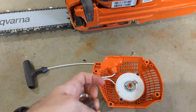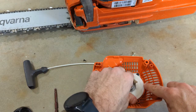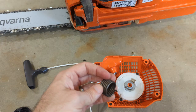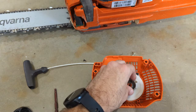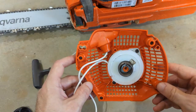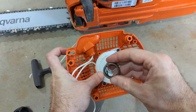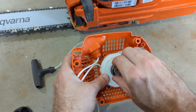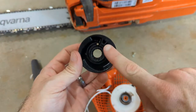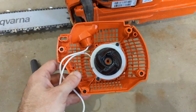So I dressed up my stopper knot a little bit. When we charge the spring - which is what we're gonna do now - first we're gonna put this in here. The spring that's charging is actually under here; that's what causes it to recoil back when you pull on it. This guy right here we're gonna put in place like so. Make sure your knot is kind of out of the way, and like I said, that goes into that little hole right here. There's gonna be two sides: one that's perfectly lined up, and one that's a little bit offset - the offset one goes into the base. Line up the spring hole, make sure it fits nice and flush, and then screw it on.